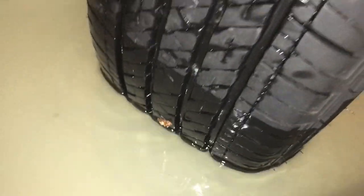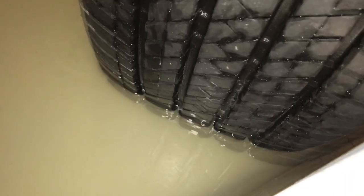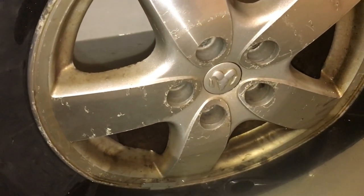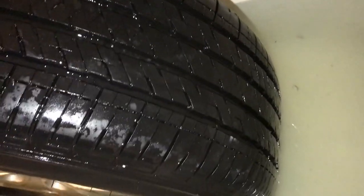I filled it full, and so then there's that spot right there — we're just gonna dip it in and look for air bubbles. I don't see any. Then we're gonna continue and go through the whole tire now, because we don't want to put it back on and there actually be another leak. So we're just gonna double check everywhere: look on the sides, front and back, and then we're also gonna check the treads.